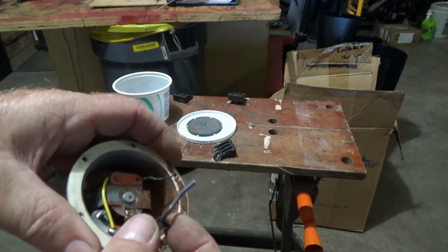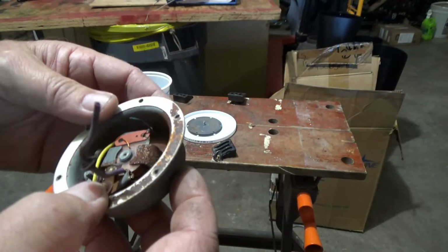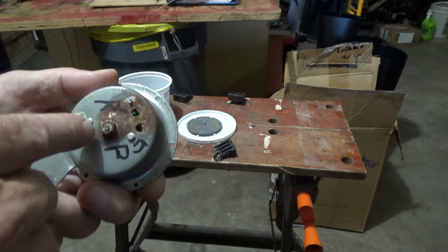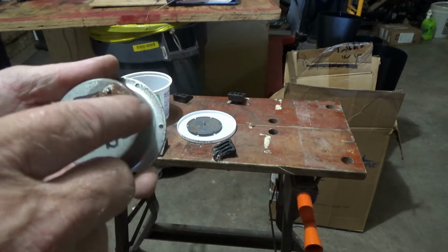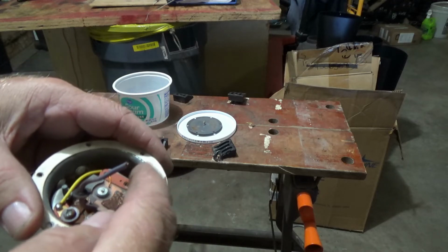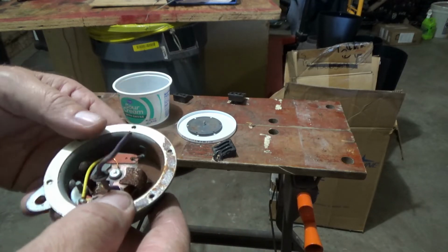This little grommet here, you see? It's a little rubber grommet. There's two of them, supposed to be, for each one of these holes to keep water out. And as you can see, apparently water runs down on this and in there. These little grommets went to heck, and one of them crumbled up. Just happened to be on the red one, which is the 12 volts always to the horn, and then when you get ground it honks. So